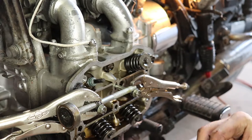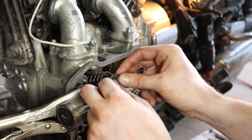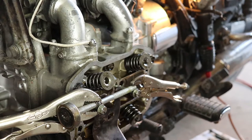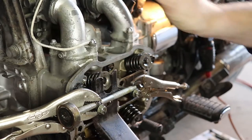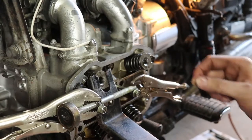Now that I've got that cleaned up, we put our springs on. Next thing we can do is lay our seat in place. Now I like to have both of the keepers in my hands ready to go, in one hand, and I'll have one in position ready to be slipped in. The other one I'll just stick in the palm and hold with my finger. I come in here, get a little press with my hand so I can get it in place. Once we get our tool in place, we'll compress that down. We'll go on in until we see where the, I'm actually going to do this a little bit further down. Here we go. So we'll compress this until we see where the seats are for the keeper.